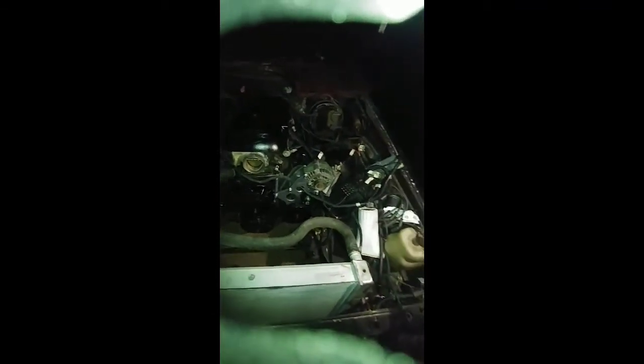clip in the 60E plug and get everything else routed. On that same one you also have to have something ran on the other side. That's for the output speed sensor on here. That way, if you're running, say, Dakota Digital gauges or any type of other custom gauges, you have to have that so it can reach a speedometer. You don't have to have a neutral safety switch on these vehicles, so it won't stop it from running. So that's on there. We're probably gonna zip tie that up.